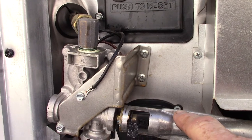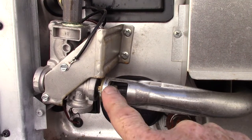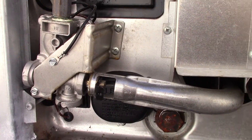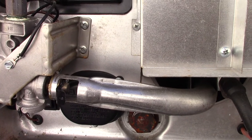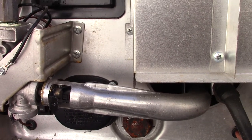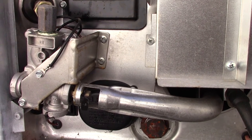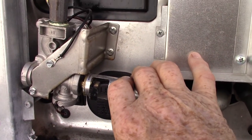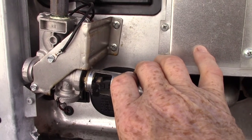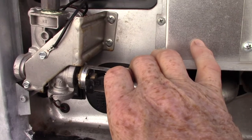You always want to make sure there is water in the water heater tank before you turn on any energy source, whether gas or electric. To confirm you have water, hook up the city water connection and turn it on, then turn on the hot water valve over the sink. If the tank is empty, it'll just blow air. As it fills, you'll get an air and water mixture, and eventually solid water coming out — that's how you know it's full.